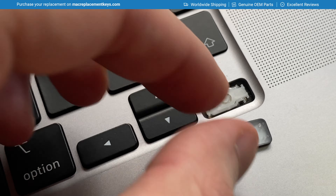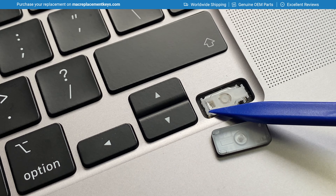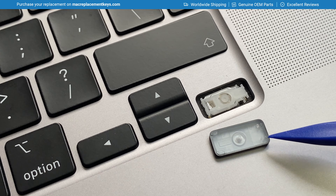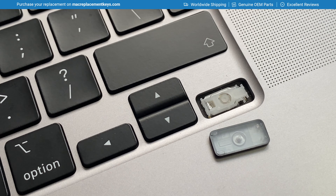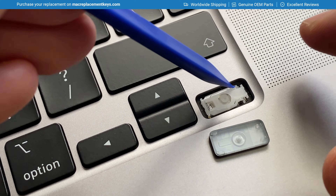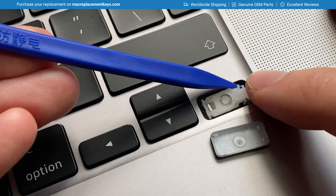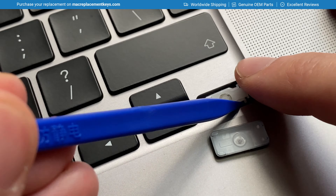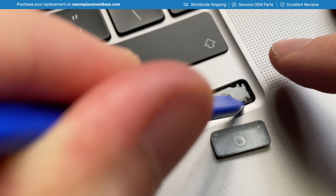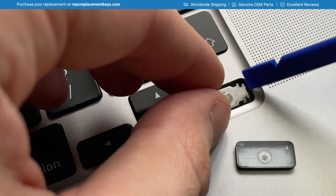The right arrow has two small hooks which attach here and here, and also two clasps which attach here and here. To remove the clip you can insert your key tool underneath the right hand side pins and gently push on the top and also on the bottom, and then the clip will be detached from the keyboard.